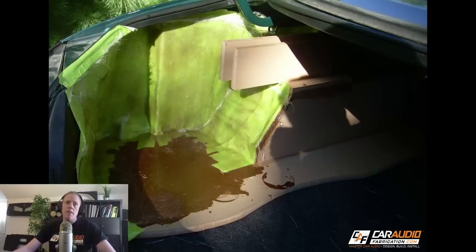To start the build process, I made the subwoofer enclosures themselves. Looking at the left side of the trunk, I made the bottom board out of MDF, framed in some of the side area with MDF, and captured the shape of the side of the trunk with fiberglass. Something I would recommend doing differently: I put the wood down first and then applied my mold tape, thinking I'd be able to remove the majority of this tape later. I should have put the tape on first, before putting the wood piece on.